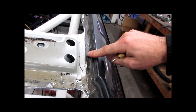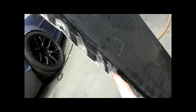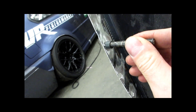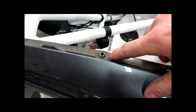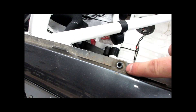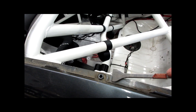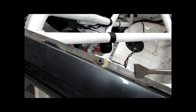Here's the roof panel off the car. You can see how I cleaned up the edge of the window and how this spot weld bit basically just cuts out the hole right around the spot weld, which then allows you to just peel the roof skin right off. As you're prepping and cleaning up everything, one area that's a little bit hard to grind through is this bead of sealer that the factory puts on. A chisel tool or even a flathead screwdriver is enough to quickly get a majority of it off, and then you can just go ahead and grind it down to bare metal like normal.